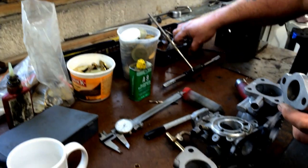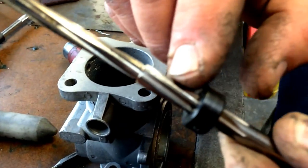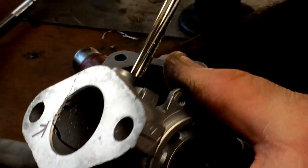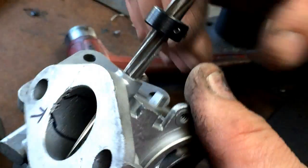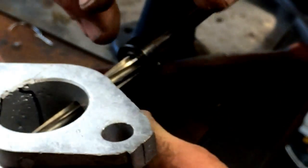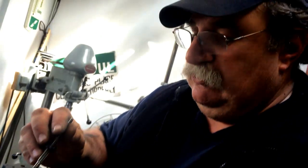The tool itself — this one's for the inch and a quarter — has a long pilot, and this end up here cuts out the body to the diameter of the bushings we have. With this pilot, it will slide in and center nicely, then you can cut the body. This stop allows you to cut it short of the throat by a sixteenth of an inch.